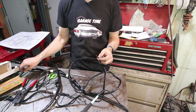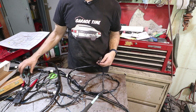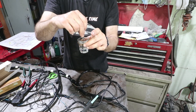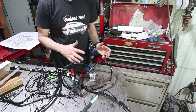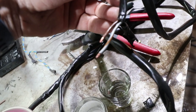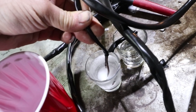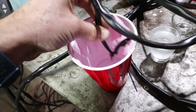It's good to stagger the joint — if the insulation ever were to fail, these two can't contact each other. So I'm going to cut one wire just a little shorter so the butt connections have no way to touch each other. This is just white vinegar with salt, stirring it to dissolve the salt. Both wires are submerged — you start to see a bubbling, which is great, looks like it's doing its work. Coming out of the vinegar, both are really pretty and shiny — can't tell a difference between which one was corroded. Now it's going into a baking soda mixture to neutralize the acid — you can see it bubbling a little bit — and then just water.